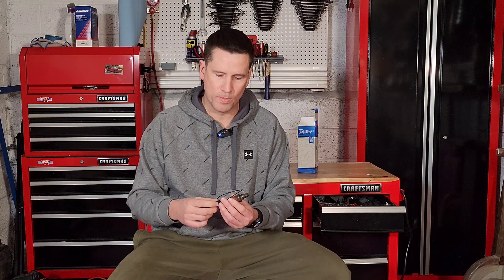That's why you really can't test one of these with a voltage tester by just probing the wire, because your readings are going to jump all over the place, and they jump so fast it's impossible to compute an average yourself. That's why you need a scan tool — so you can look at what the engine computer sees. It'll have a readout called the rich-lean flag, and you'll see that change every three or four seconds. That is the average of the voltage the oxygen sensor is putting out, so the engine knows whether it's running too rich or too lean.